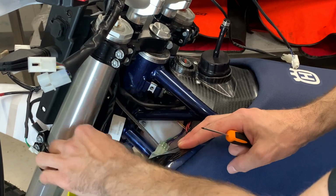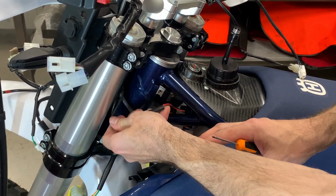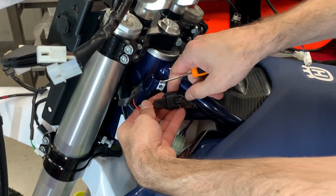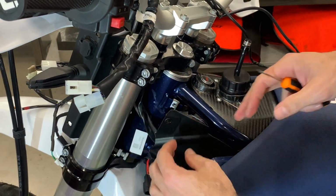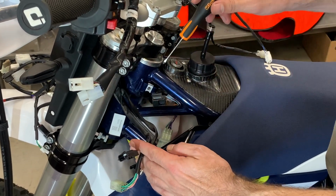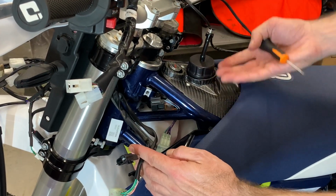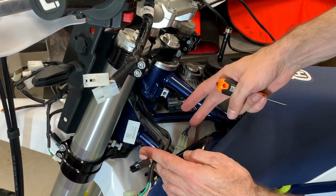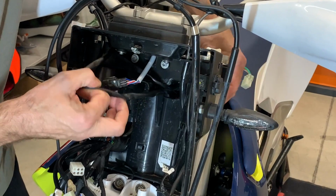Now we can get one connector out. Now you take the other one. It is this black one. Here is one more tongue. You push it and you pull and it's out. One more remark, if you cannot access it, they might be tightened by the zip tie to the frame tube. So you lift up the original cover and you cut the zip tie here, and then you easily can pull out the cables. And now finally we can pull out the cables.